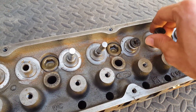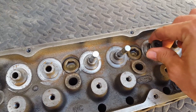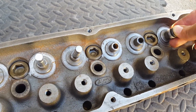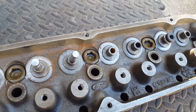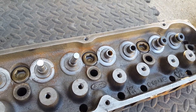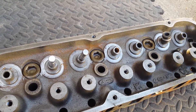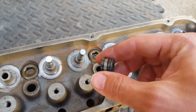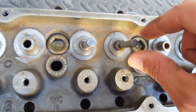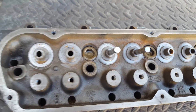The other thing you need to be concerned with is whether you're leaking oil because you have bad rings on your cylinders — that is definitely a possibility. You could be leaking oil through your cylinders. If that's the case, you need to do a compression check or perhaps a leak-down check on your cylinder heads. But if you do a compression check and everything checks out fine, well, congratulations — you just need to spend 20 bucks on these little buggers. Find the fitting that blows air into the cylinders to keep these valves up so they don't fall down into the piston.